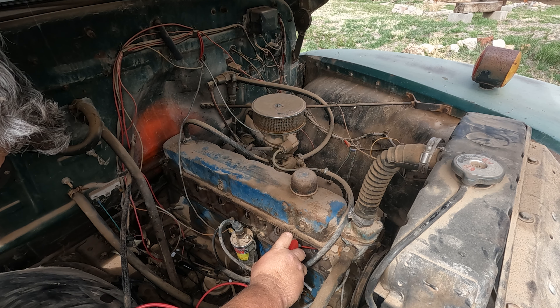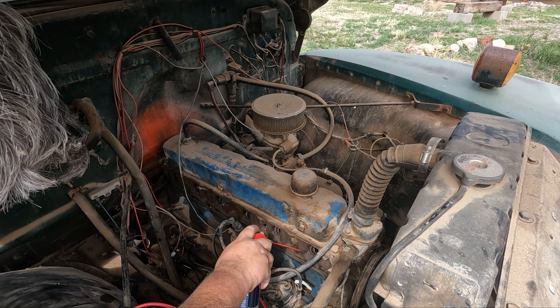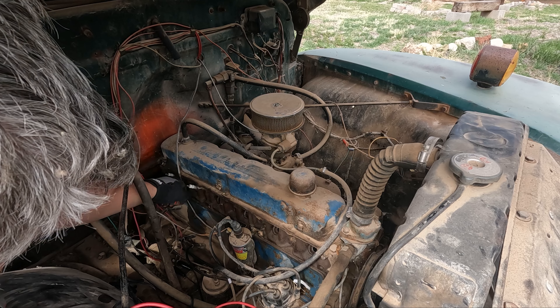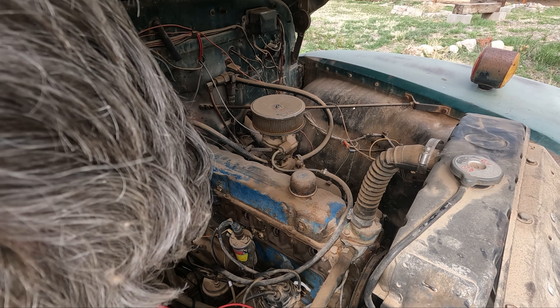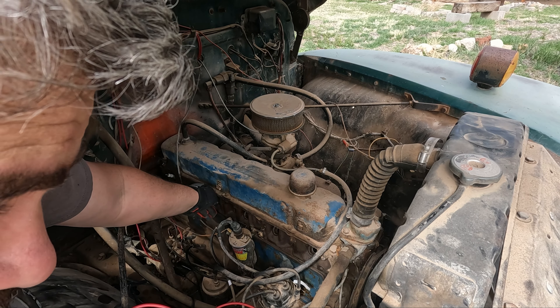While the spark plugs are out so I can see if the engine's locked up, maybe I can still turn this thing — maybe I got enough beans without spark plugs in it to make it go somewhere. That starter also might be engaged which may break it free. Yeah, it doesn't want to move at all. I think there's a PTO — maybe the PTO's engaged. I'll pull the starter out tomorrow and check it again. I don't know enough about these old trucks — might have to pick grandpa's brain about it.